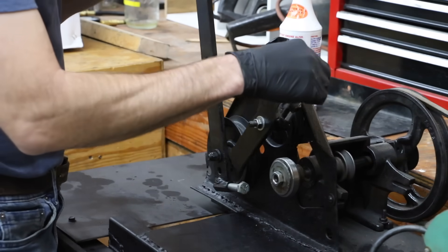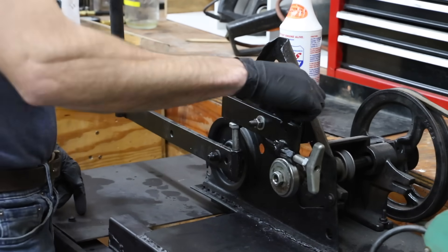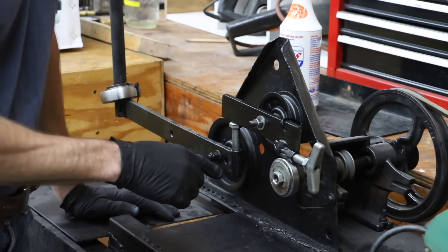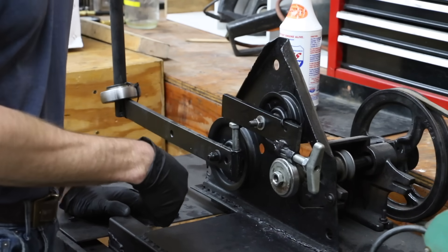I will not be changing the amount of weight. I'm only going to be doing two 30-second tests using a downward force of right at 12.4 pounds — I previously measured this in a different video. This is going to spin for 30 seconds, and then we're going to take the bearing out and see how much damage there is.